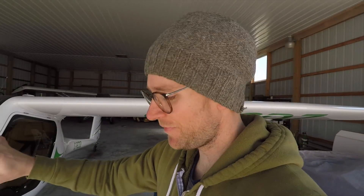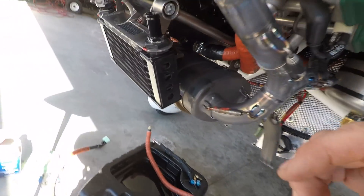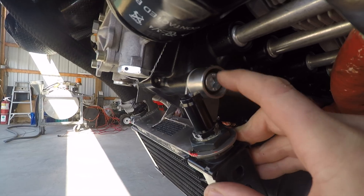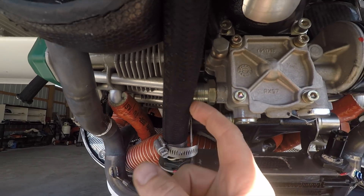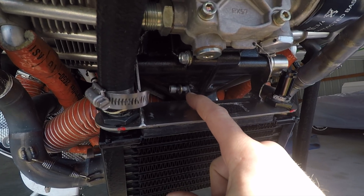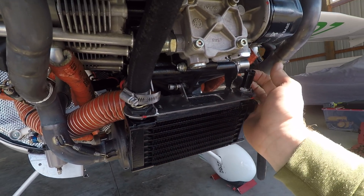It's the next day now. I got the connectors on to connect the hoses, but down here I have an issue. This new 5/8-inch fitting — or 10AN fitting — is too close to this round bracket and I just can't get the hose on. Over here I also have an issue where the new hose is too close to the oil pump connector. What I'm thinking about doing is cutting off this piece on the actual oil cooler bracket so I can angle it further back, giving more gap.